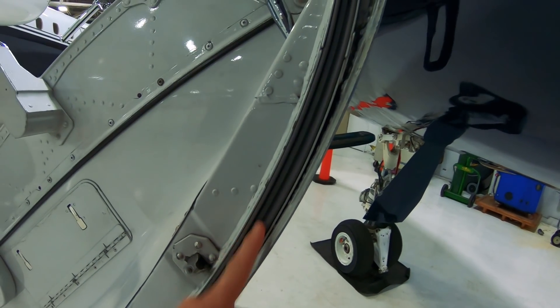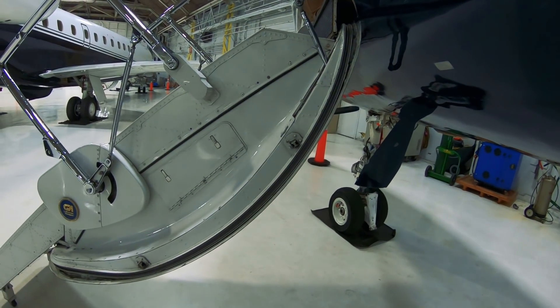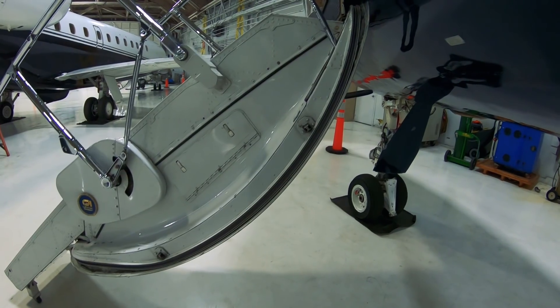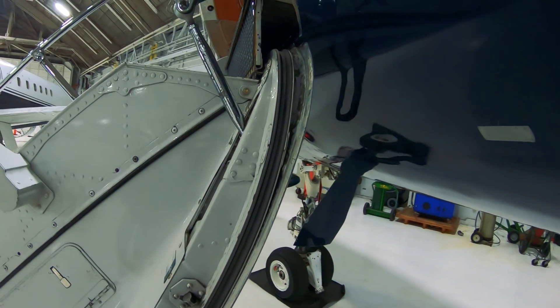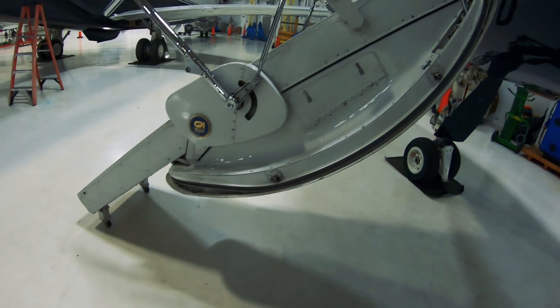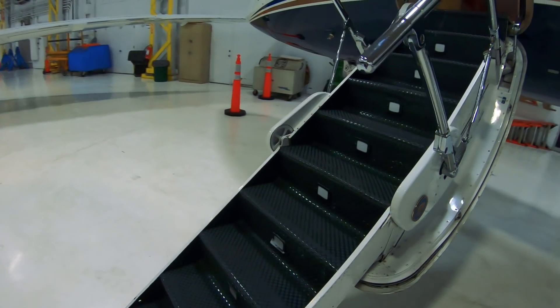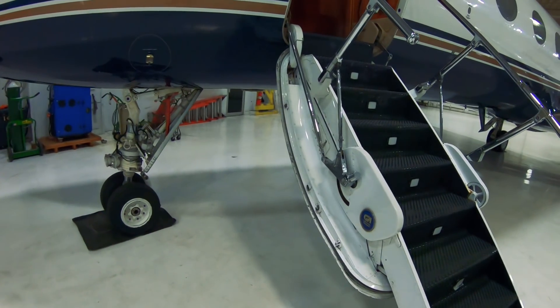What happens from time to time is pilots in a rush will open the door too quickly and won't let the seal deflate all the way and pull in. When they push it open it can rip the seal. So for those of you flying the line: there's actually a ball on the inside of the door — a little red ball — that's what deflates the seal. Hold that up and open for about 10 to 15 seconds until the seal completely deflates, then open the door. Do it too soon and you can potentially rip the door seal and cause pressurization issues.